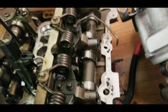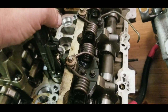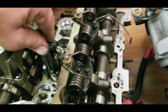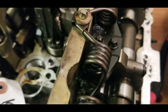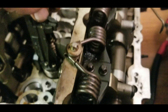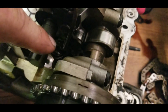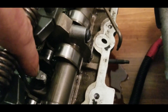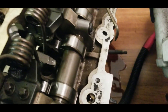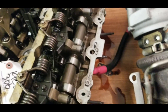You can move it with a 4mm Allen wrench — just put it in there. There you go, just move it and turn it. You see the wheels over there, and that shaft starts moving and this one starts moving too. You need to adjust it to remove this one, and also under this gear there is another head bolt.